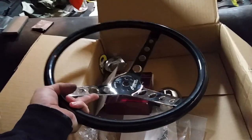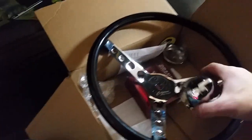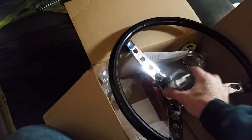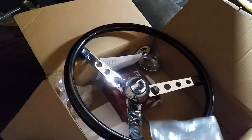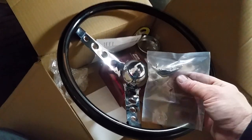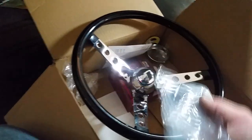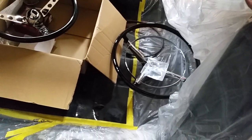This Moon is more of a vintage steering wheel. I've had quite a few of these in the past — I did this on a '56 some years back and always thought it was cool. I got the bullet-style horn button for the Moon wheel, and it has pretty much the same curvature as the factory steering wheel center, so you can buy a reproduction emblem for your Bel Air, 150, or 210 and put it on there. You just have to drill two holes and it mounts the same as an original. Now instead of putting that emblem on the Moon wheel, I can put it on my new reproduction steering wheel, which is pretty cool.